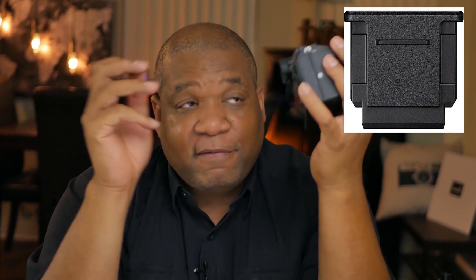The way you can test it: take your lens off, turn the camera off and back on. If I do that, it will automatically show me the error message. So I took the lens off, turned the camera off, turned it back on — still got the error message. So now I know it's not the lens; I'm focused on the hot shoe. What I found is that water got inside the hot shoe and shorted it. The camera was thinking there was some type of flash attached that wasn't compatible, so it was giving me that warning.